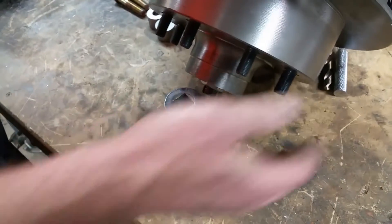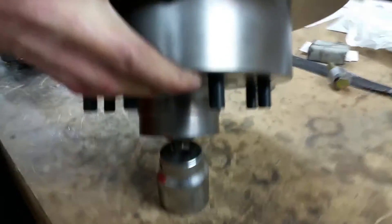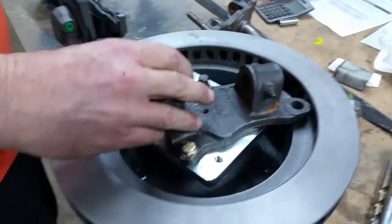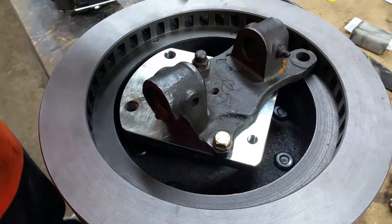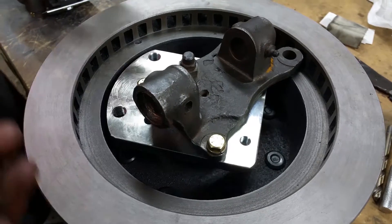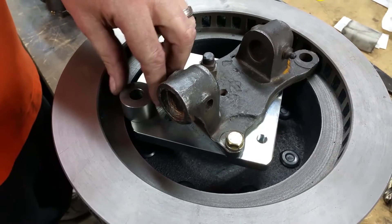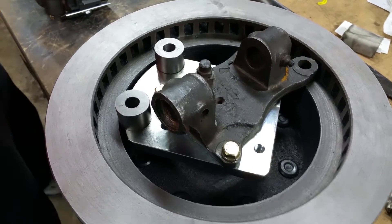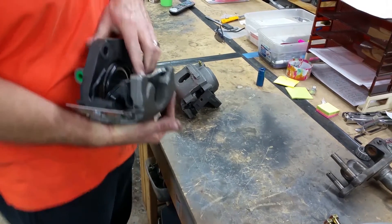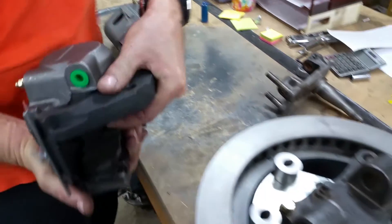I'm just going to use something to help me out. Of course, yours would be bolted on the truck all nice and neat, and things wouldn't be wobbling around. So I'm going to try to situate this. Here we go — we've got our spindle right here, and basically it's in the 10 o'clock position. Our spacers go right there — those are our caliper bracket spacers. We take our caliper as an assembly, as we put it together in video two.